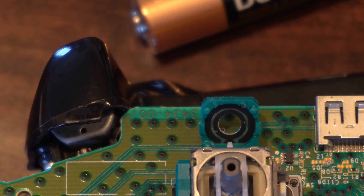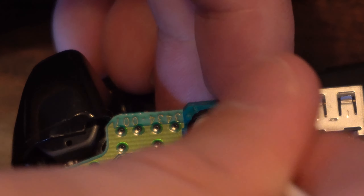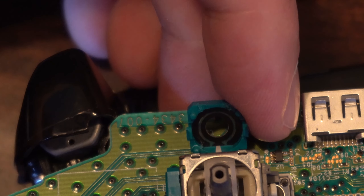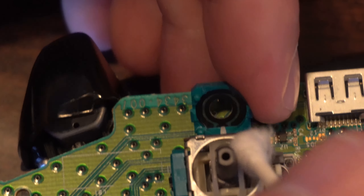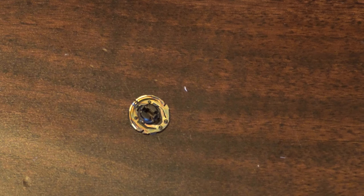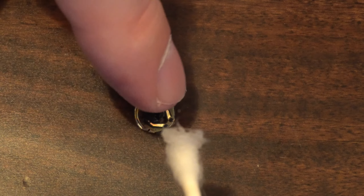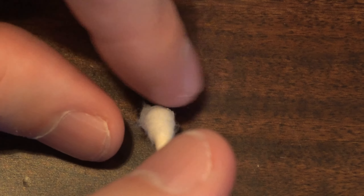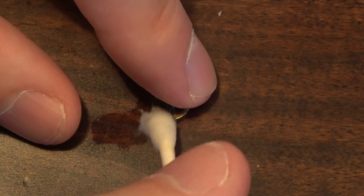I'm just going to put this into the cap. I can take this rubbing alcohol and put the Q-tip right in the area that we went ahead and opened up. If you have an old controller, you might get a bunch of gunk and debris on this. I don't really use this controller all that much, but it looks clean so let's just clean this off. You might want to take some compressed air once we get everything reassembled and just dry it off. Then you can go into this area here too and just clean it all off. Let's do the same thing on the little piece we took out. It should just look metallic and reflective — make sure you get off any kind of debris, gunk, or black marks.